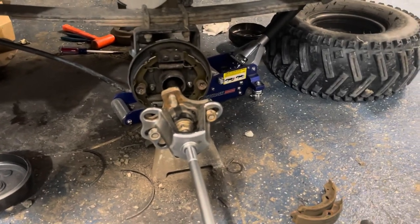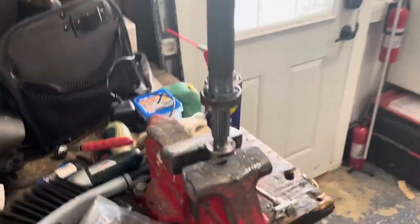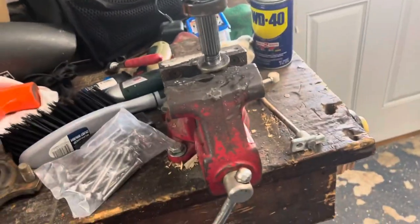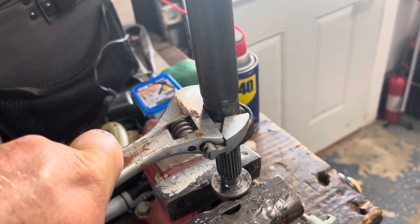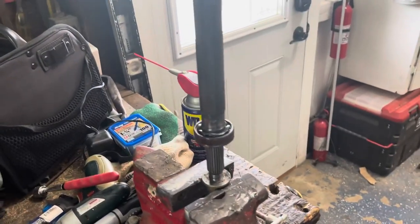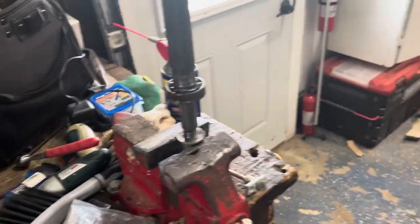You can see there's a bearing and then the seal is in there. I'm going to go ahead and pull this axle shaft out. Before I do the seal, I'm going to do the bearing. I have the nut on the end of the axle. You can see that that bearing is trashed. I'm going to set this crescent wrench here — I'm actually surprised Dan doesn't have a bigger one, but it's probably somewhere I just didn't find it. I'm going to set this on here and hit it with a hammer and beat that bearing off. I did spray it with a little bit of WD-40 to give it some lube. I won't be able to show it because I definitely need two hands and I'm not working in my shop. So you get the picture.